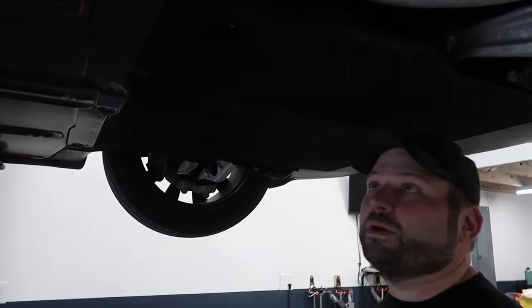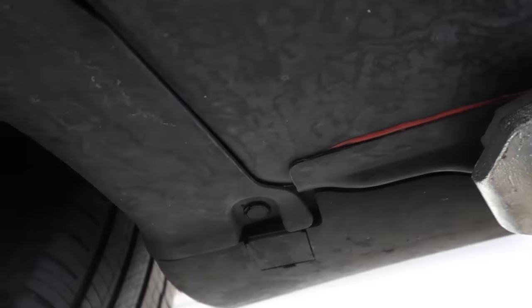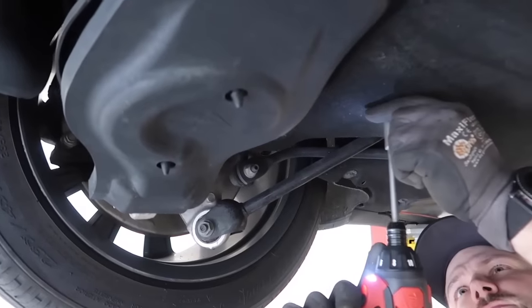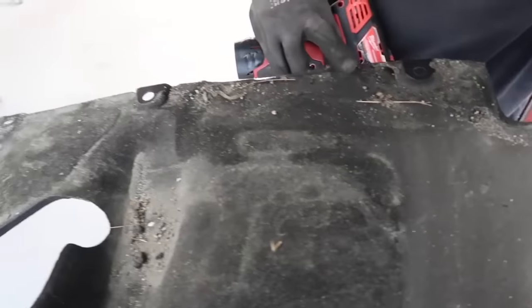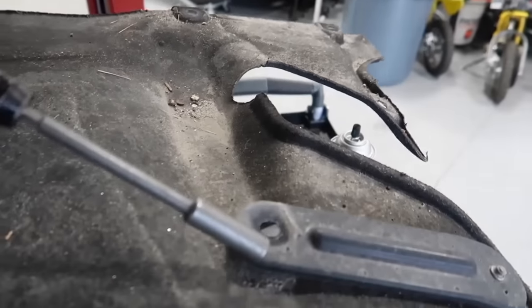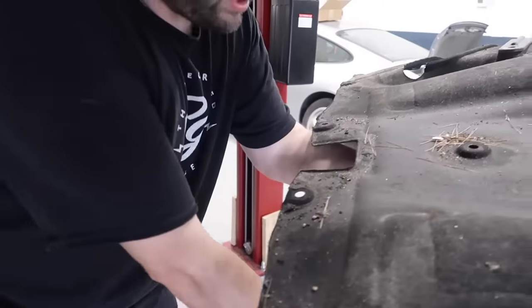That's a lot better after cleaning. We had a Model 3 the other day that was missing these, so the inside piece was actually just flopping around. We do have some odds and ends of debris down there. Oh, look at that — that wasn't even installed right. The bolt was actually in front of that part, so that right there is a rattle too. It's a good thing we took it down. I'll take it outside and shake it.